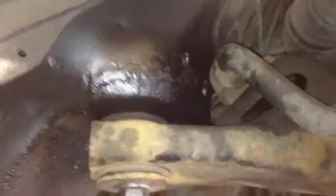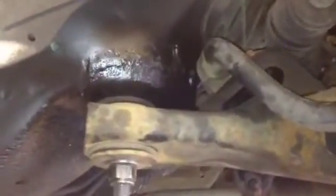This also had a very worn set of brake pads. A couple of mil left on there, when they should be that thick. Rather than coming back in a couple of weeks, I've done them now. So it's got a new set of brake pads on both sides, and that's the chassis that we cut earlier. And there's our new bolts all fixed up there, lovely. So just got the seat to weld and then we're done.